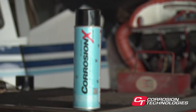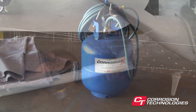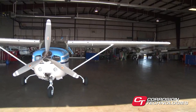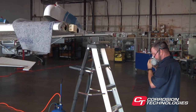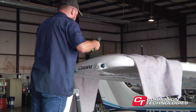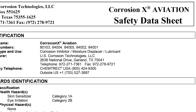Before we get started, let's take a minute to talk about safety. CorrosionX is non-flammable and does not contain any volatile organic compounds, the extenders or diluents found in other corrosion inhibitors, which can harm the environment and dilute the product. Inhalation of any chemical should be avoided. We recommend spraying in an open, well-ventilated area. Precautions should be taken when working in enclosed areas or in areas without proper ventilation. Since CorrosionX has an oil base, take care to avoid treating components that are normally affected by hydrocarbons, such as oxygen fittings, some silicone rubber seals, and butyl rubber used in pressurization valves. A good rule of thumb is that if hydrocarbons like oil, fuel, or gasoline won't affect it, neither will CorrosionX. Please refer to the product container and the safety data sheet for more details.